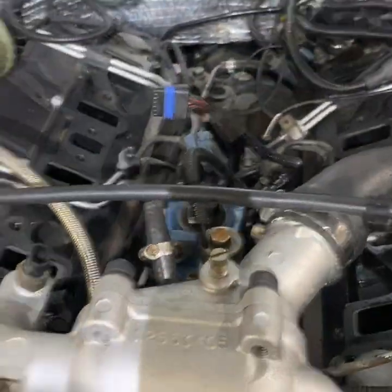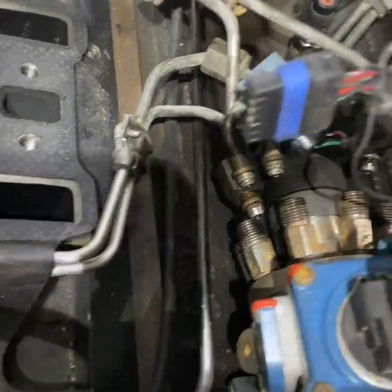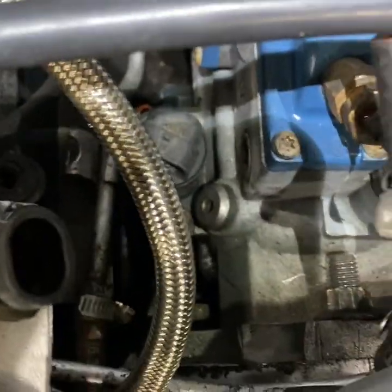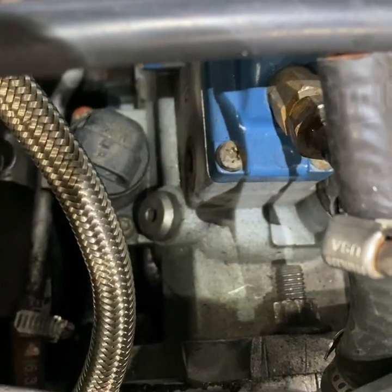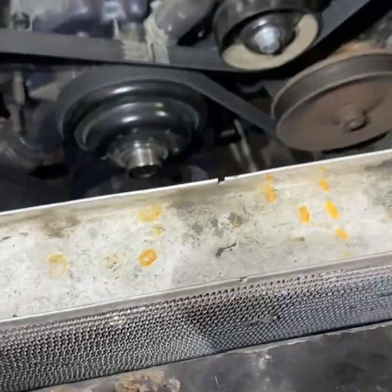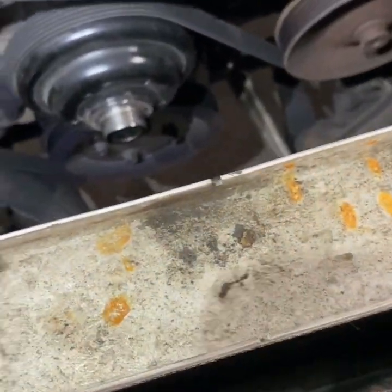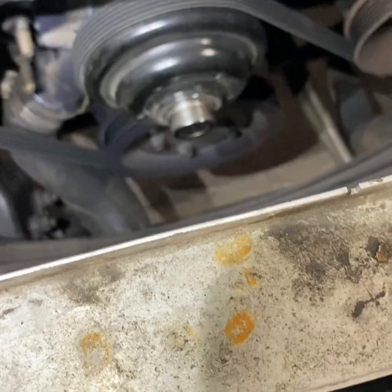So I have all the injection pump lines off, the bottom two nuts off, and the top nut cracked loose but still there. For this job you don't need to remove your fan shroud and fan like I did, but we are doing a fluid damper today so it just makes it a little easier. I can also show you those three little bolts inside here - you can only see two right now - but those are 13 millimeter and you're going to have to rotate the engine over. I just leave the belt on for this purpose.